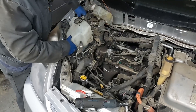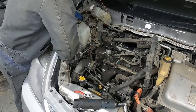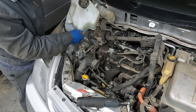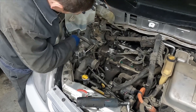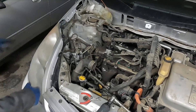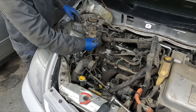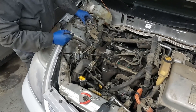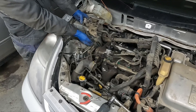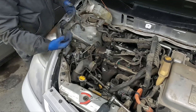Get to the electrical connectors - should just be two: one for the front pump, one for the rear pump. So now we got our hoses. I missed recording a bit, but we got the bottle out. The next thing I did was just took off our bracket that our brake reservoir was connected to - two 10 millimeter bolts up top, one in the front. This little hose here was pushed in right here - just take a pair of pliers and pop that out. We just have to set it aside - no big deal.